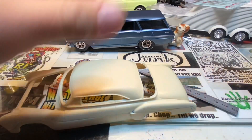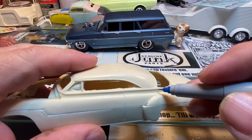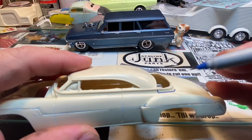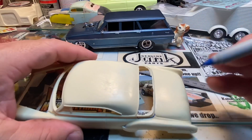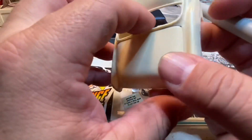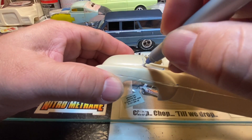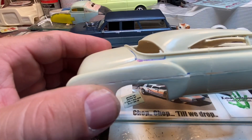The best way to do it is to come down right here and cut around it, cut across right where the trunk lid meets the tulip panel. That's not marking too well - that's the mold releasing in the crack down in the gap there. Then on the other side we're going to follow the same idea, so that's going to be where we're going to cut it.